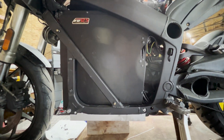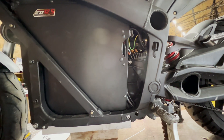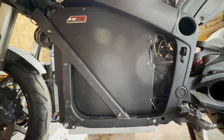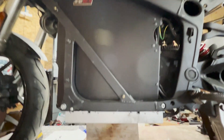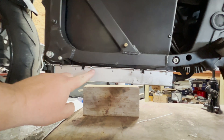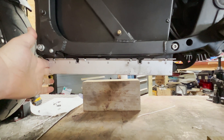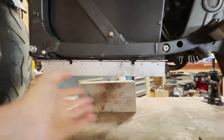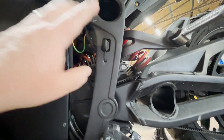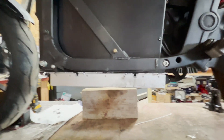Here on my RS, the battery was easier to come out of the DS because it has a smaller motor, so there's a little bit more finagling in the RS to get it in and out — space is a little more cramped, but all in all it's pretty simple. If you head over to New Zero Land and go check out their videos, he has an awesome video on how to remove the charger at the bottom of the battery pack. There are about 12 screws you undo and this thing just pops right out. There are a couple zip ties you have to deal with, pull out your plug and a couple little wiring things. It'll take you 10 to 15 minutes and that comes off.